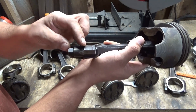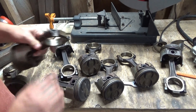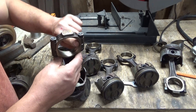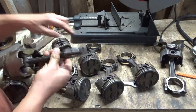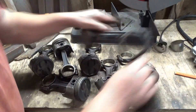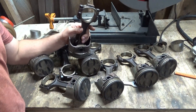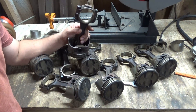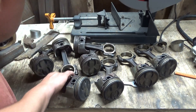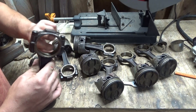A lot of them on the side feel like they have the caps mismatched. I kind of have a feeling they've been mismatched because some of them are very smooth — like this one's almost perfect, the side's not exactly perfect. The way you get this sorted out — I don't know, that's why I haven't built the engine yet. I could probably take them to a machine shop; they probably have a way to measure roundness or resize them.